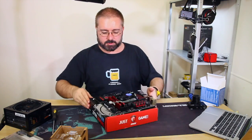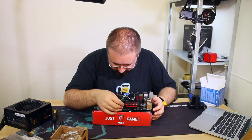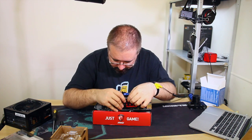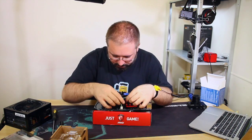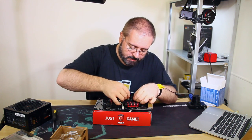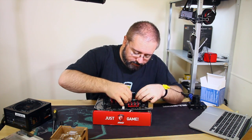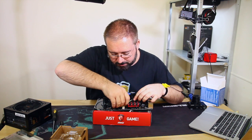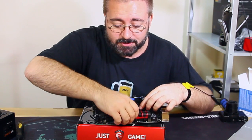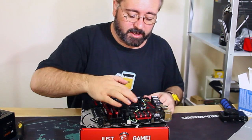All pins are locked into place. Connect the CPU fan up to the CPU fan header on the motherboard - it only plugs in correctly one way around. The heatsink fins are kind of delicate, so be careful. Then just tidy up the cable run a little so it doesn't interfere with the fan blades - tuck it under the heat sink.